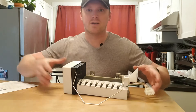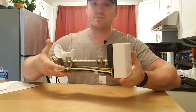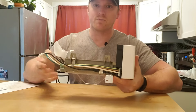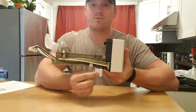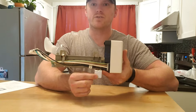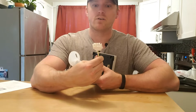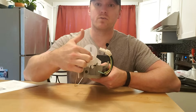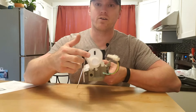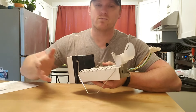This is the ice maker here. You don't necessarily have to pull out your fridge — I just pulled it out for ease of showing you guys. There's usually a screw right here, and if you have one of these brackets down below there'll be a screw there too, just those three screws. Then you have your wiring plug — push in on the little tabs and pull it out. The tube coming out of your fridge will go right into this inlet here, so when you put it back make sure that tube ends up back in that hole or else water will go everywhere.